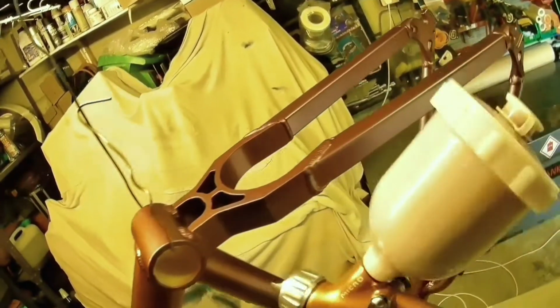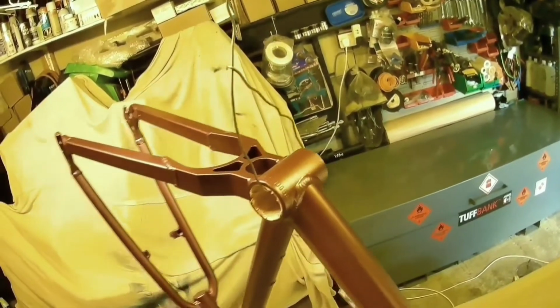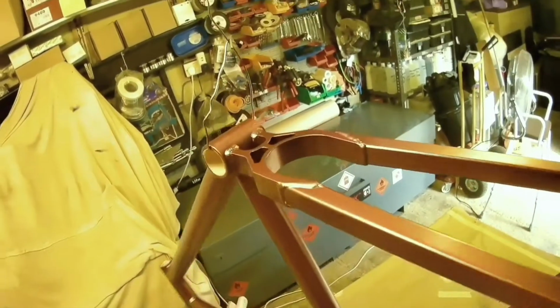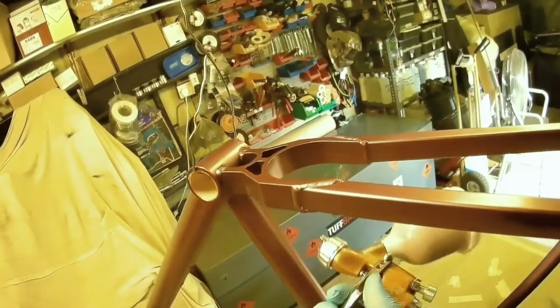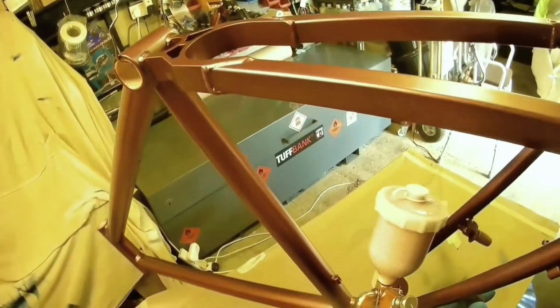So you'll see me towards the end spraying more over the bottom of the crossbar, simply to build up a layer of paint. Then what I did was take some 1000 grit wet and dry, and you just sand it down until it's all nice and smooth. Leave your base coat in your gun or in the can, what you've got left, and when you smooth that off, make sure it's clean and there's no residue or dust anywhere, and just respray that area, and it blends in nicely to the rest of it.